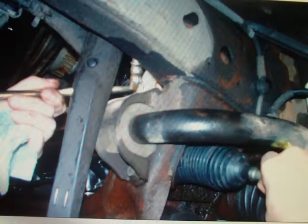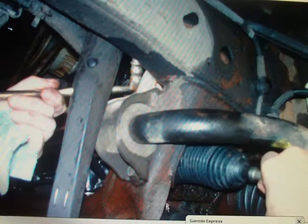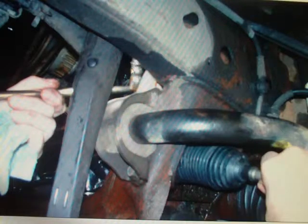We're coming in on another angle, and here I'm pushing the tie rod, because that turns the power steering, which goes up to your steering wheel, your steering rack. So when I push this, it moves that, and it gave a better position for the socket to get at it. So you're going to have to do that as well, push and pull on this to turn that bolt so it comes into view, so you can undo it and release the steering connector to the power steering rack. Put your hand up in there, lift it off, and it'll just pop off.